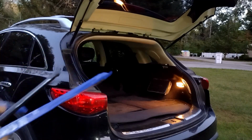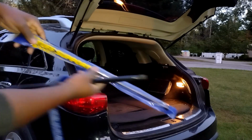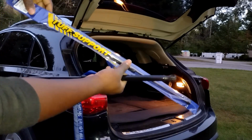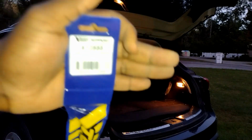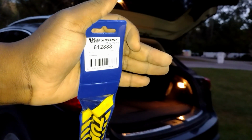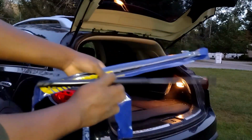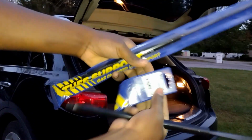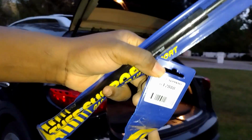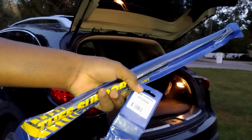And my choice of a replacement is these two gas struts from Tuff Support. They usually offer a lifetime warranty. The part number you'll be looking for is, if I can see it right here, 612888. And I will share these part numbers in the description box. It is the same part number in this case, which is usually, the front of this vehicle did not seem to care, but the rear has a left strut and a right strut.